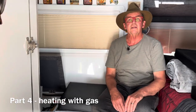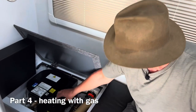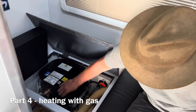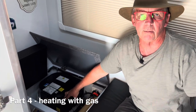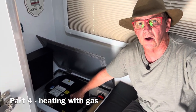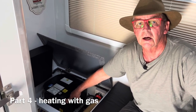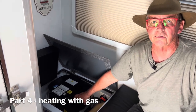If you don't get that click and you've got your switch on, you need to check whether you've got actual 12 volt supply. In this corner there are two Phillips head screws — take those out and lift the corner up, and underneath there is a circuit board with a 1.6 amp fuse. Check to make sure that fuse isn't blown. If you've got a multimeter you can probe the two points where the power supply comes in and make sure you've got 12 volts. The cutout voltage is 10.5 volts, so if your batteries are low the hot water system is not going to run.